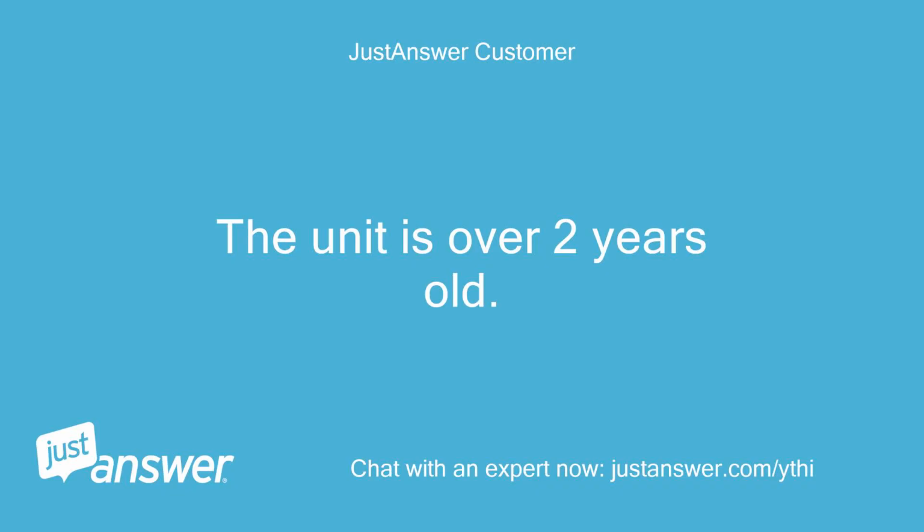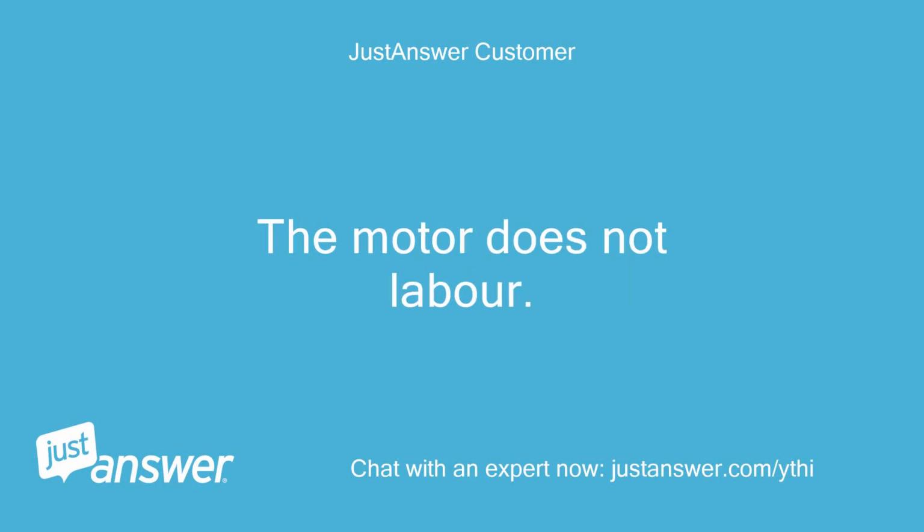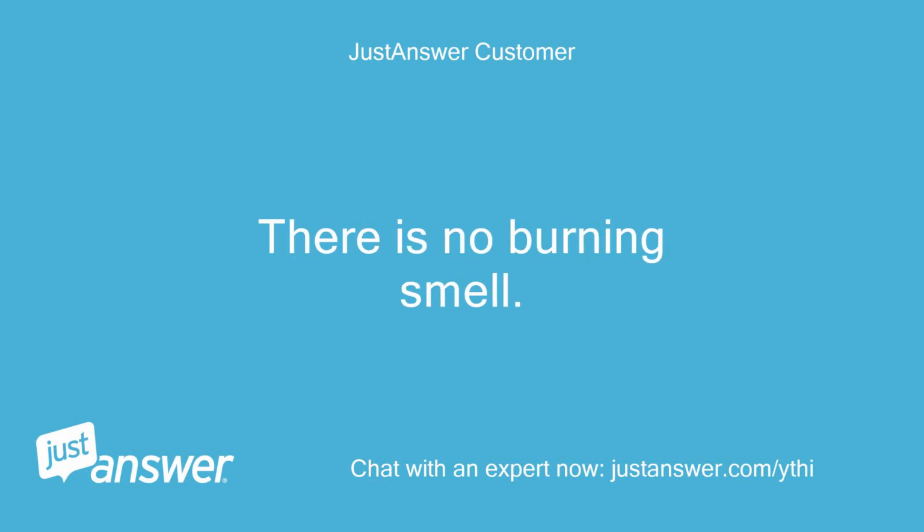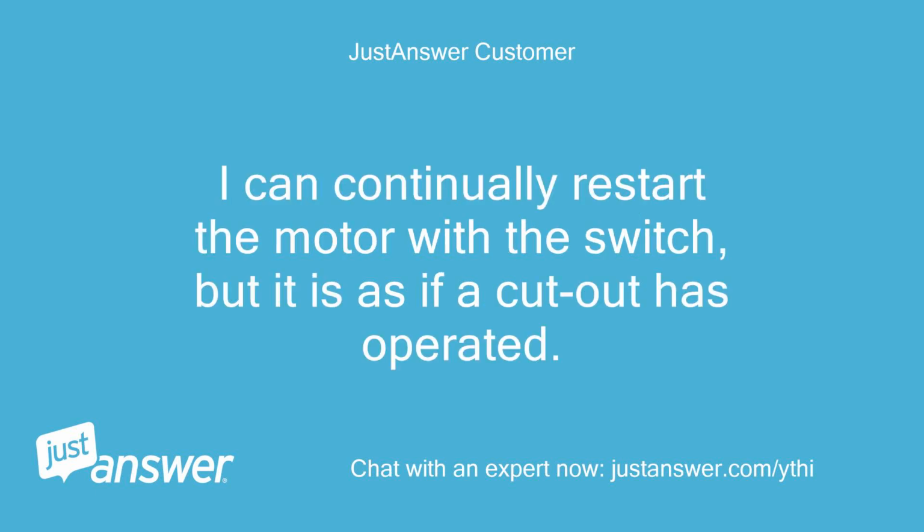The unit is over 2 years old. The motor does not labor. It just stops as if the overload circuit has cut in, but there is no load on the motor. There is no burning smell. I can continually restart the motor with the switch, but it is as if a cutout has operated.